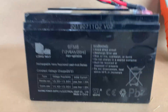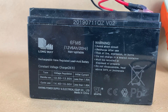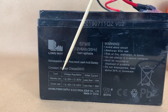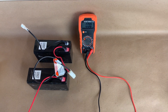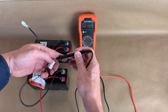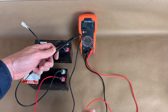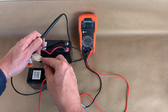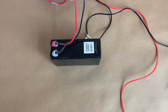Now let's test the batteries. It's a 6FM6 model with 12V output. Usually the most common problem with scooters is that the batteries are discharged and not taking charge. So let's test them with the multimeter. Mine is showing only 1.9V — that's too low. The other one is showing 0.9V — also very low. Good ones should be showing about 13V output.